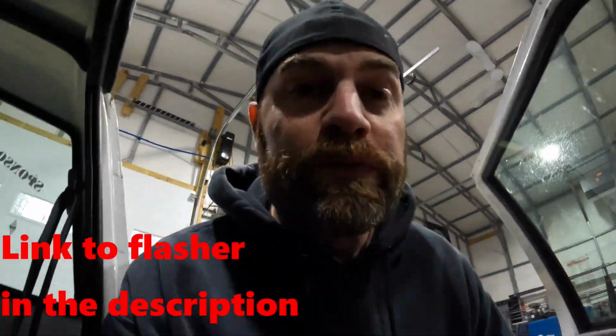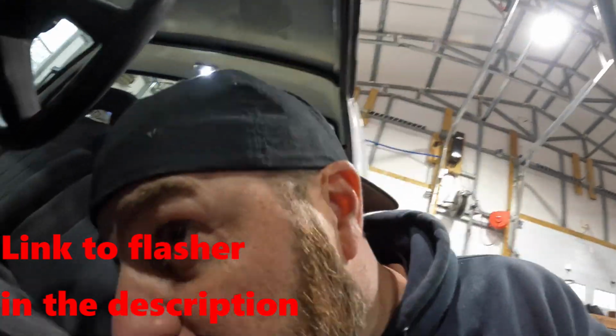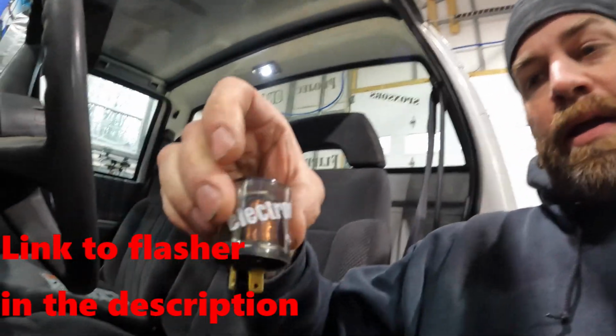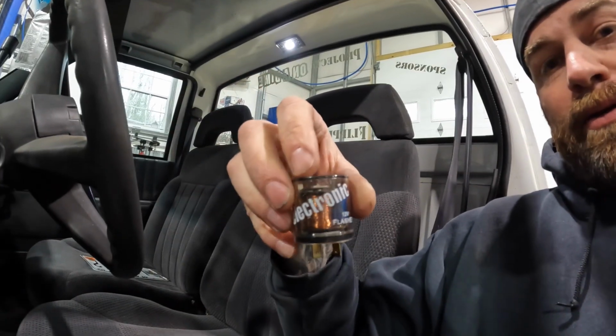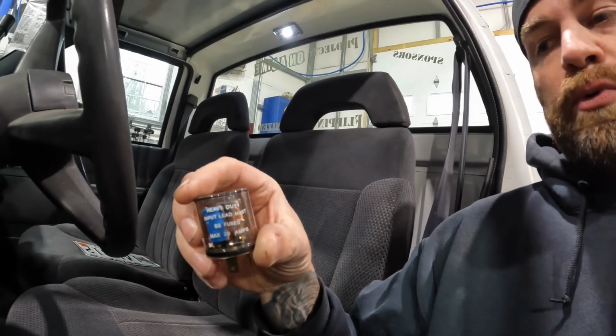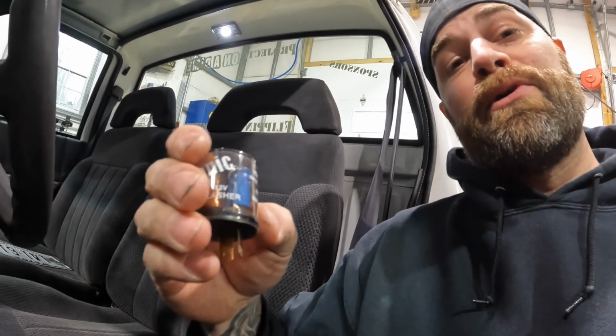All right, guys, update on the flashers. Remember how the blinkers didn't work because we changed to all LEDs and I ordered an electronic flasher? Well, I just put it in, and there it is right there. And I'll put the link in the description. It's literally right on Amazon. It's huge compared to the other one. It's just a 12 volt heavy duty 20 amp flasher, and the blinkers work perfect now.